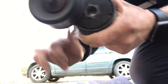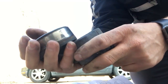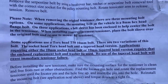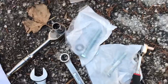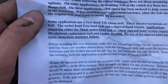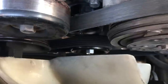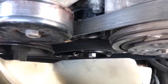Even when you spin the pulley, you can hear the bearings have dried out and this pulley just needed to be replaced. Now, as you can see in the instructions here, they wanted to make very clear that if you had an application which required the 10mm socket head or a tapered head version, you have to use these enclosed bolts — otherwise, immediate tensioner failure will result. The bolt on this one was an 8mm. It's a new tensioner, and you can see the belt is riding much more evenly on the pulley.